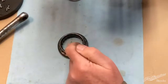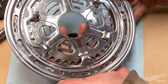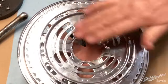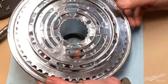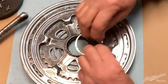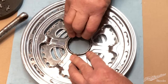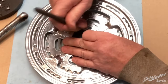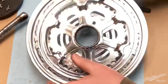The other benefit of taking this piece off as well as all the other things is that if you want to clean this assembly with some Evapo-Rust, letting it soak and then wire wool scrubbing on there, it's best to obviously take everything off that you can. So now we'll put it back together. Put that on there like that. Get the snap ring in. And that's all in now.